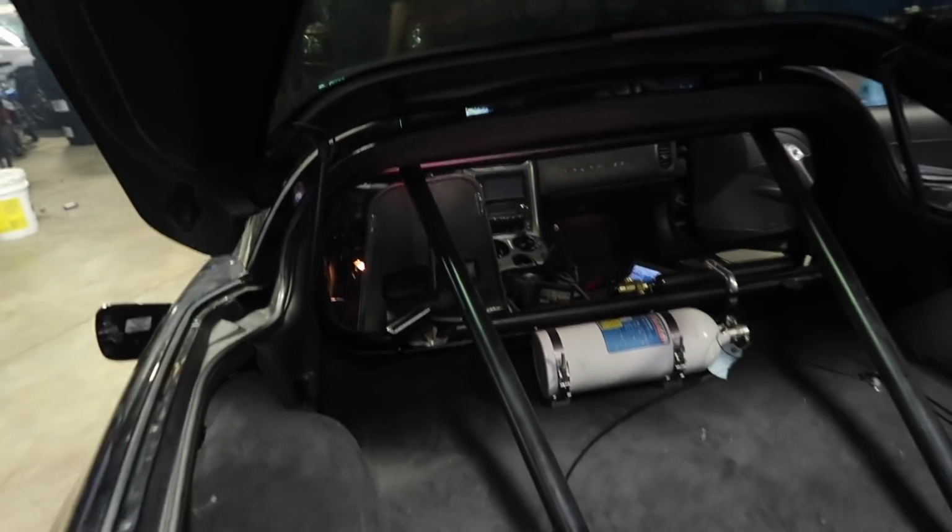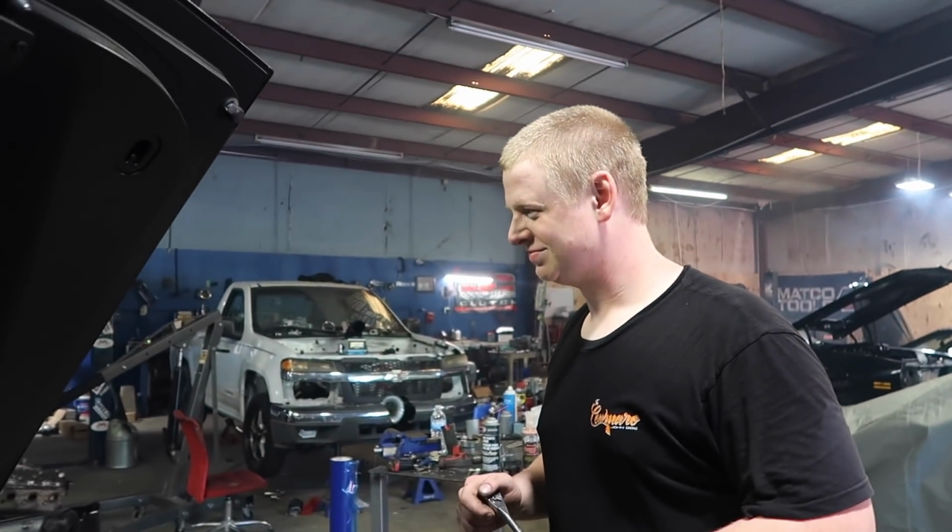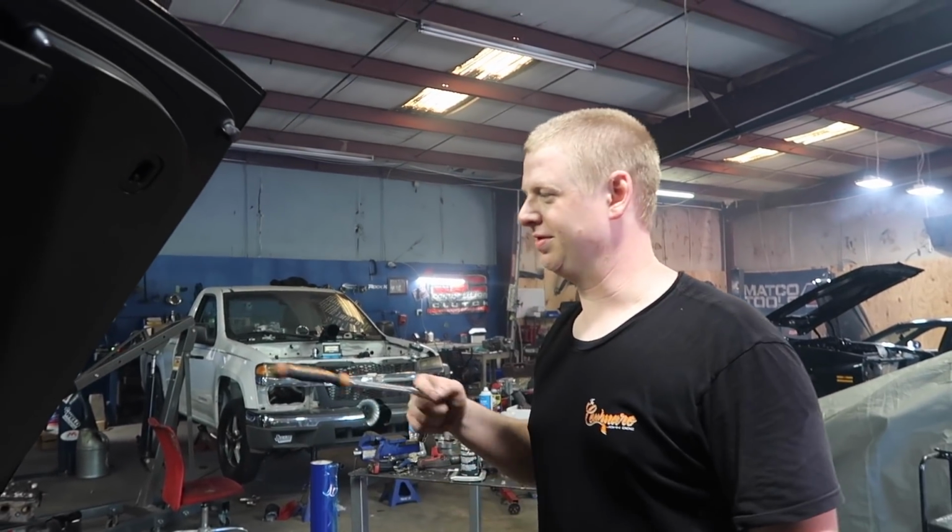That thing is unbelievable. Everyone at home is going to be like, oh, it's smoking. But that's what happens when the scavenge pump doesn't work. There's literally no way to get that oil out of those turbos when the scavenge pump fails. We do it on the Black Sheep all the time. That's why it was smoky.